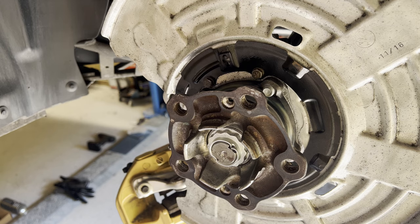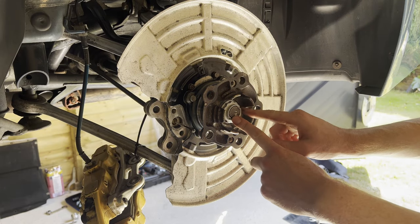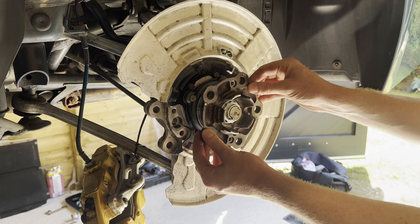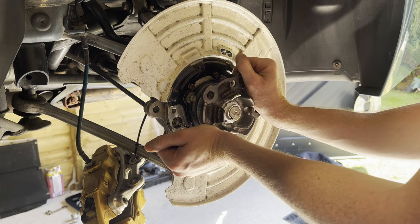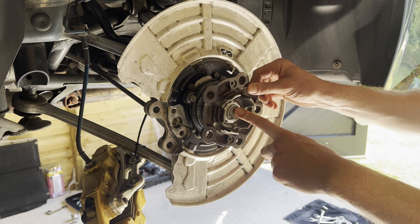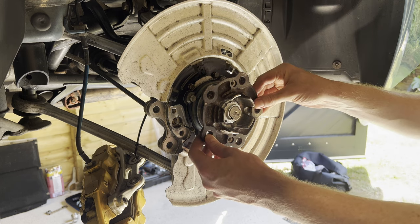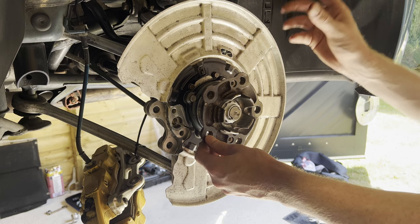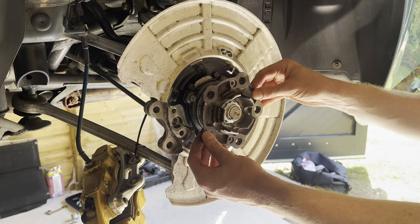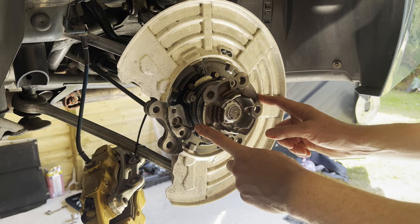And that's two. All right, so what I'm thinking here is that the axle puller pulled the flange and the part of the bearing back together, like it pushed it all back together, as well as the fastening of the axle nut with a lot of torque. So I think we got away with hammering the axle from the rear. Having said that, the hammering was not that excessive. First of all, I used a piece of wood and the hammering wasn't that hard. So now we're going to install the handbrake assembly.